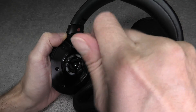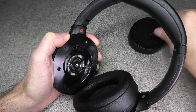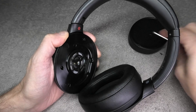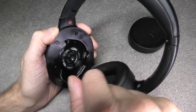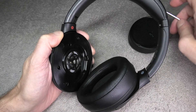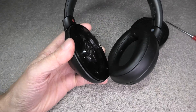There's a really strong magnet in there, and if you get too close with the screw, the screw will get sucked in. It would be really difficult to remove, and we're also in danger of accidentally damaging the driver, and then the sound just wouldn't be the same as it used to be. So always be careful with those little screws — don't accidentally drop them into the center of the ear cup.